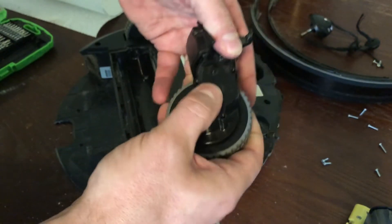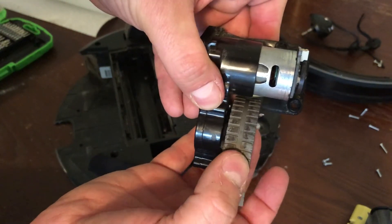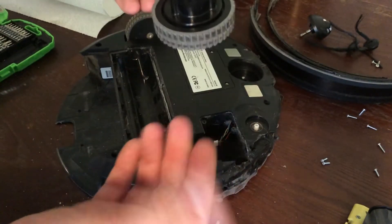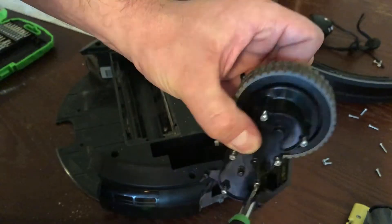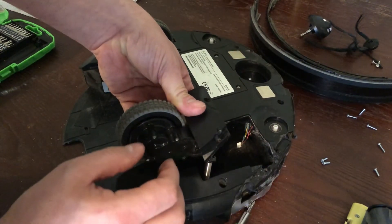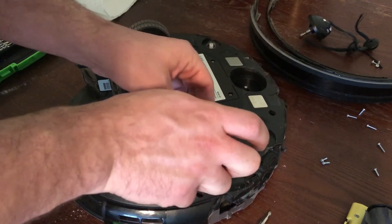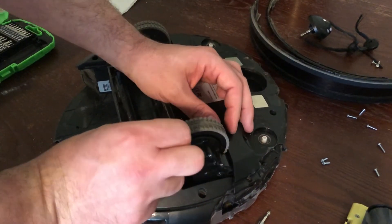You can see the motor inside turns properly, so she's good to go — didn't get any dirt in there. We'll get these screws back in. Putting this back in, first thing to do is the spring — the spring goes around and just clips on. Reconnect the motor — only goes one way, so just make sure it's on there solidly. Don't pinch the wires. And down she goes.